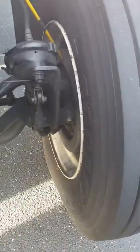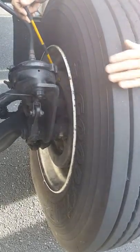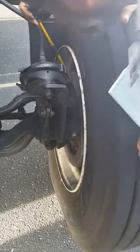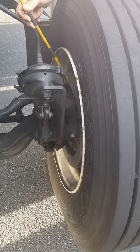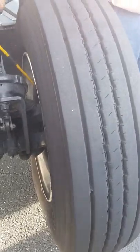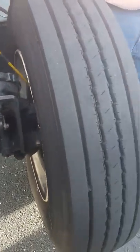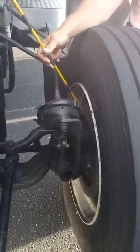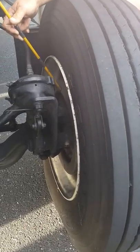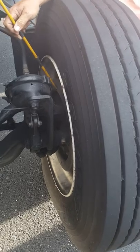I cannot see my brake drum and shoes because I have a cover over them, but if I could see inside my cover, I would be checking that my brake drums are securely mounted, not missing any nuts or bolts, no rust trails to indicate anything was loose, and the drum itself is not cracked, welded, or repaired, with no heat distortion or warpage. My brake shoes have good thickness of pad — at least a quarter of an inch — and I see no oil or grease contaminants on my brake drum or shoe.